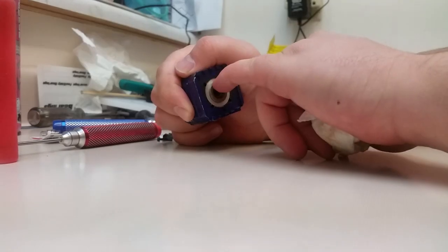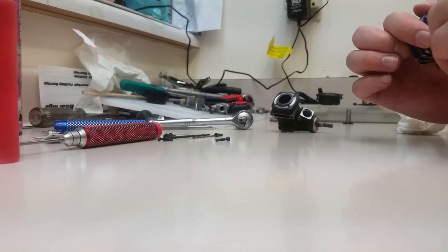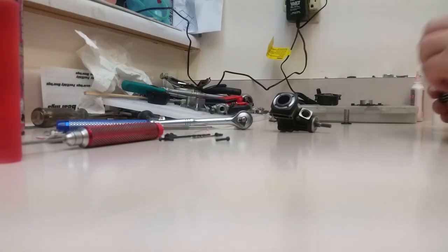You also want to make sure there's no stuff, like any kind of crap stuck to the head gasket surface, because if there is, your head gasket will not seal properly. And, okay, we're just about looking good here. Just a little bit more.